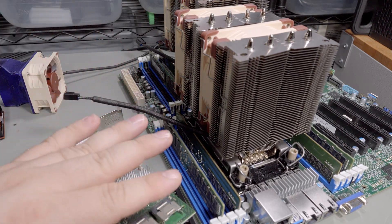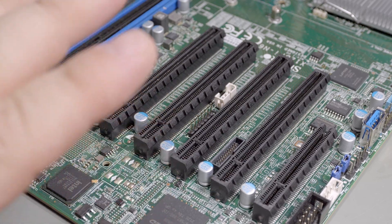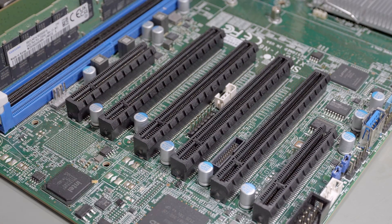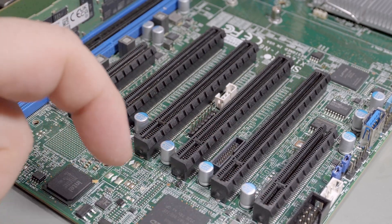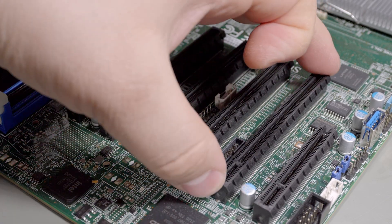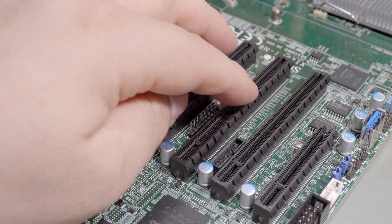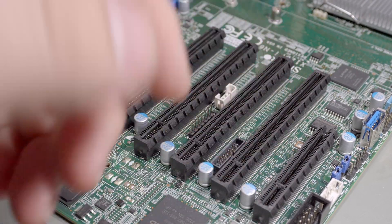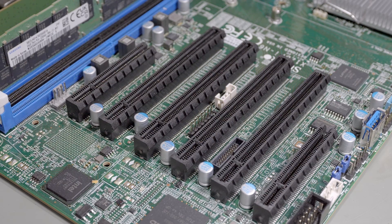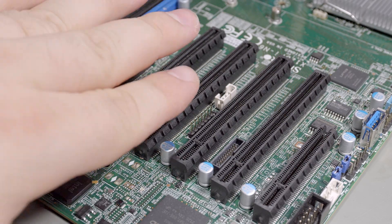I'm going to install a whole bunch of cards — I think every slot is going to be full except one. I really like that this motherboard is loaded with PCIe slots, all PCIe 4.0 and all capable of bifurcation. It's a little weird in the BIOS — they all claim to do 4x4x4x4 implying they're 16x slots instead of 8x. I had to set one to 4,4,4,4 to make it work. They just have it listed as a 16x slot for some reason, but bifurcation works, so I can bifurcate my two-drive card and the quad card.